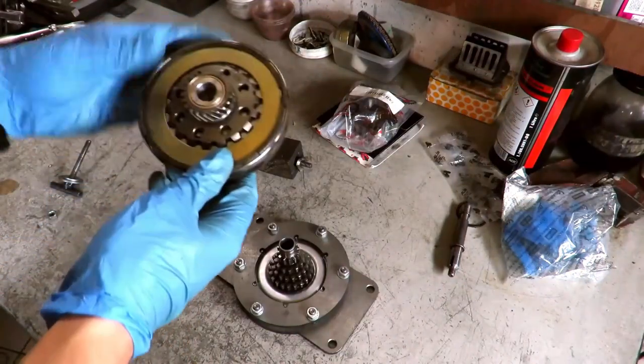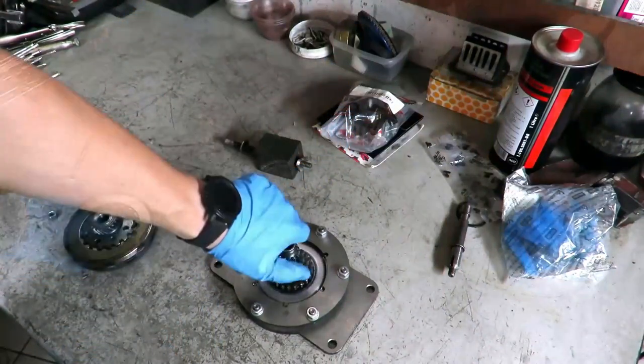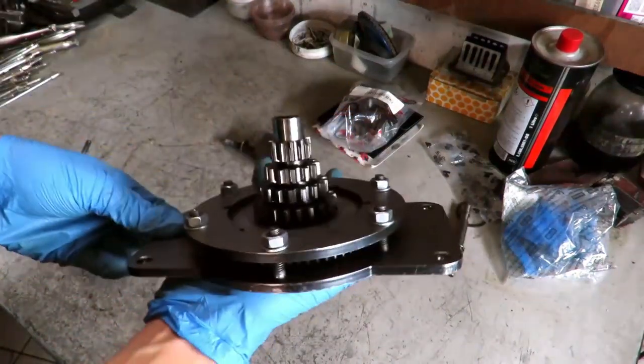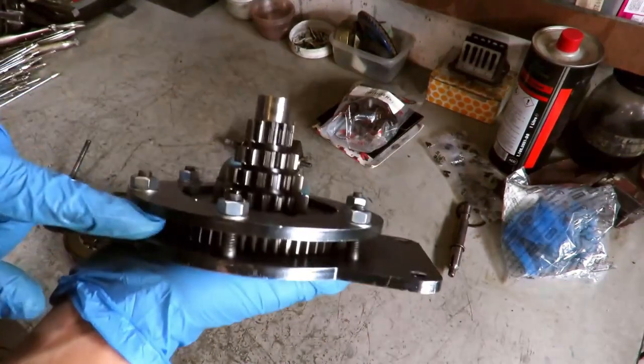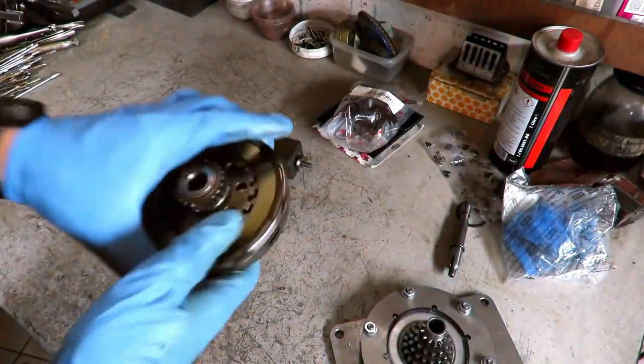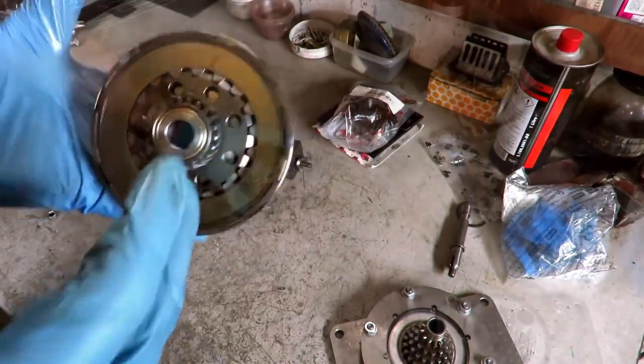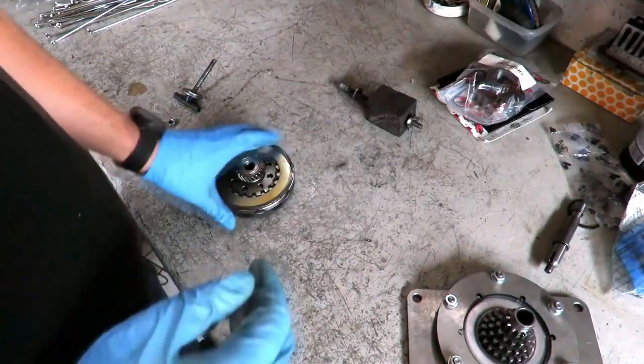This is the clutch that also houses the pinion. And this is the quadruple of the four gears, the cluster, on which the primary with straight teeth has already been mounted. Let's start with the clutch and I'll tell you what precautions to take to make it work with this very high torque thermal unit.